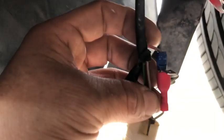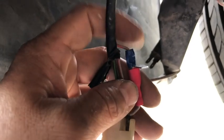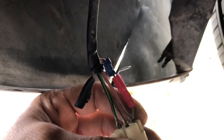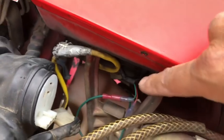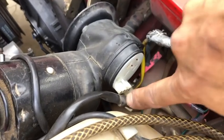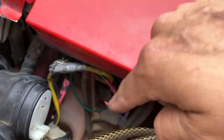I spliced into one of the gray and red wires, and as you can see there are two connectors there — similar to the one I just showed. I clicked in on this side, and that's my connector going to the turn signal for the LED light bulbs. There's an opening right there. I took out the relay and removed the power so I can control it. Here's my connector — I'm going to zip tie it to the end of the chassis so that when it goes up and down it only pulls from that end.